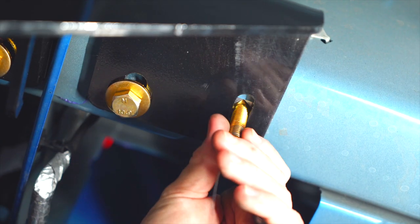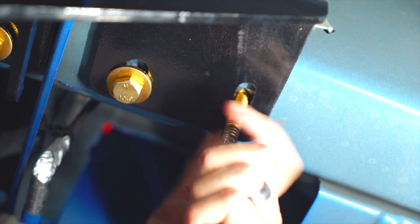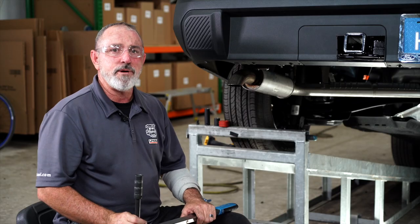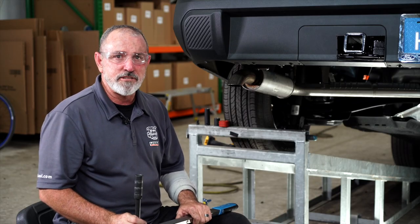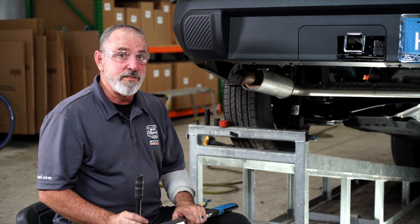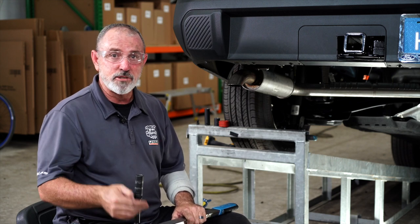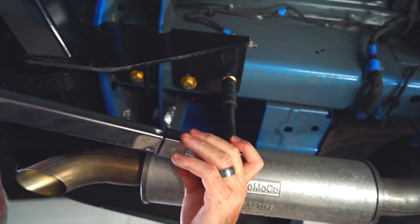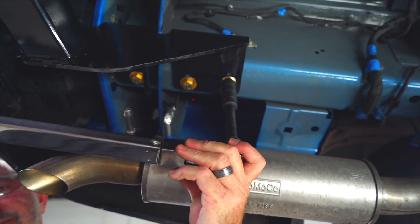We're back on the driver's side. We're going to remove the fish wire and install our provided flange nut, again with the teeth facing up. We'll repeat on the passenger side. Now we're ready to tighten and torque to the manufacturer's specs — you can find those specifications in the description or in the link below. For the most forward bolts, I'll be using an 11/16 socket with a 5-inch extension.